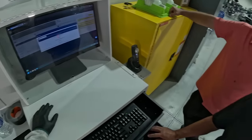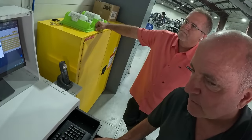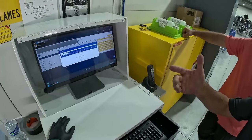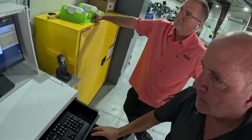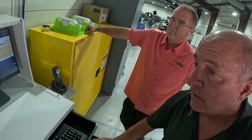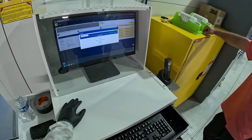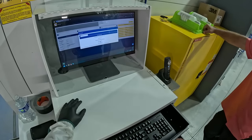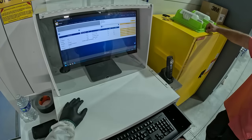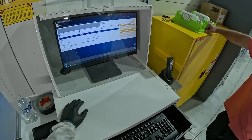Next. What are you thinking about for make that? Make it sprayable, see here? 16 ounces? Yeah. That should be plenty. Okay. You're only doing the fender and both sides of that hood, and a little bit under blends. Maybe 14. And you're going to do your bumper. Yeah. I can get through that with 14. Okay. You're going to make it sprayable. I put sealer in here for you so you wouldn't get confused. All right. Click sealer and add your hardener and your reducer. We're going to put our amount, 16 ounces.